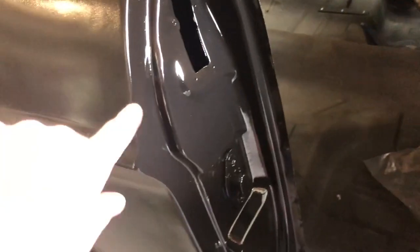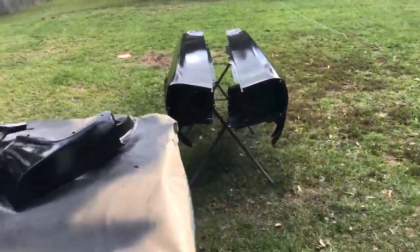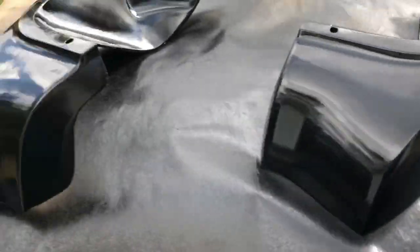But I sprayed this again just because you could see the Bondo, the body filler, behind the epoxy, so I'll put another coat on here to build this little hole up. And you can barely see it right there. Hit it with light just right, you can see it, but it filled it in pretty decently. I'll probably end up going back and body filling that to top it off, or whenever I spray that 2K or filler primer, it might fill it up. Recoated this, same thing, body filler, you can see through. Recoated the inside, same thing. You might still see it because this was not sanded real fine. Yeah, you can see where it's rough versus where it gets smooth. Maybe. It's hard to see this on camera because it reflects. But I also recoated these. They came out pretty well.